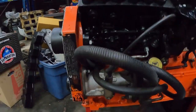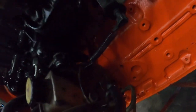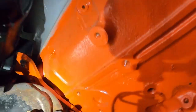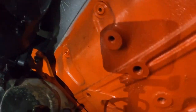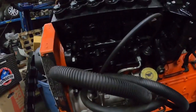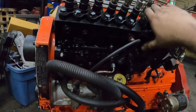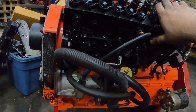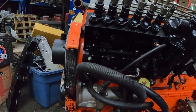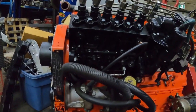The pump will just go right on there, but you do need the bracket. There's a bracket that bolts to the injection pump and to the block — you do want to have that on there. These things take an immense amount of load to run, so if you don't have that bracket on, you will break your injection pump or your timing case off.